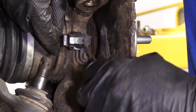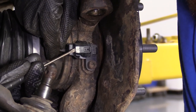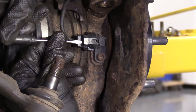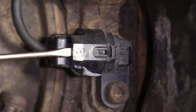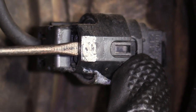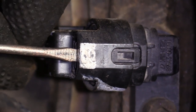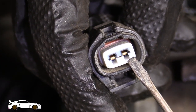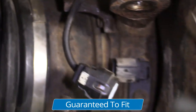So I'm going to try to get my pocket screwdriver in here. When I go in between right here where this white dot is, there's a little nub — a squeezy nub. You can't grab it with your thumb because it's in there, so you need to use something small. Wedge it in, give it just a little pry and it lifts up on that little lock. When that lifts away, you can just grab this and wiggle it to disconnect your ABS wire. You always take a peek — make sure there's no funny colors in there, no reds, greens, blues, rust, dirt, water. That looks really great.